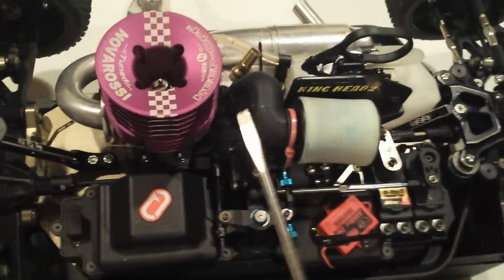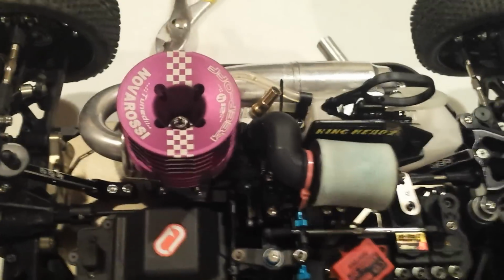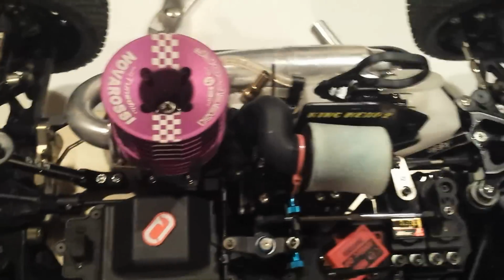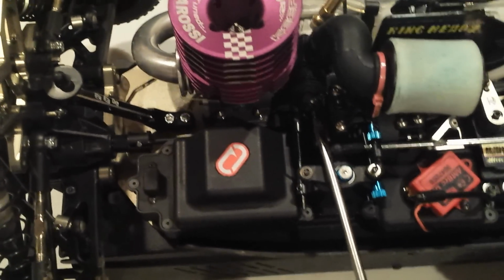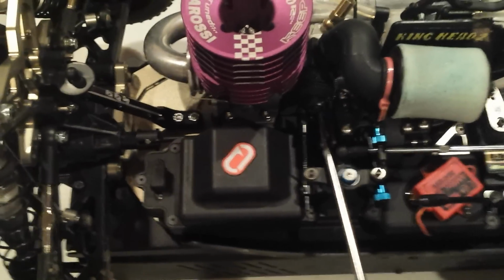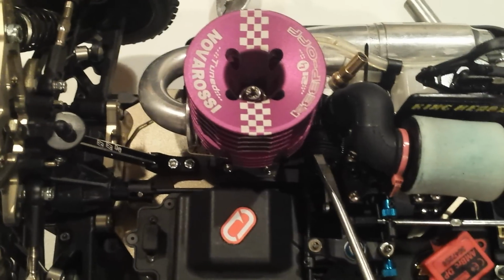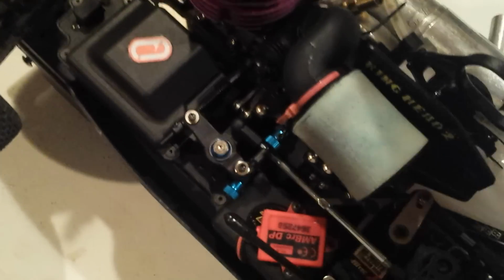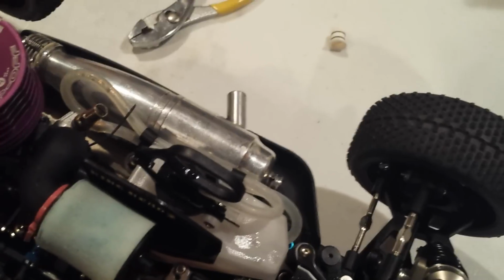Once, after you make a pass, your engine drops down and starts to load up, four-stroke and start loping, and sounds like it's going to stall or does stall, then you start leaning out your low end about a 1/16 of a turn or so in, and remake another pass until you get it to lay down. Once this starts leaning out, then you go back to your idle stop screw and back that out, and it should come down right after a high speed pass and lay right down to a good stable idle.